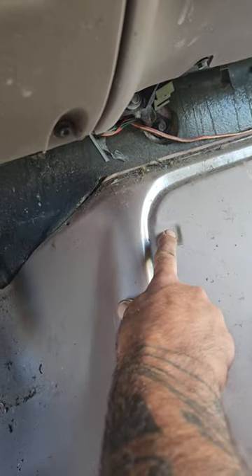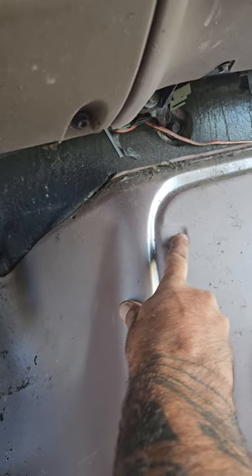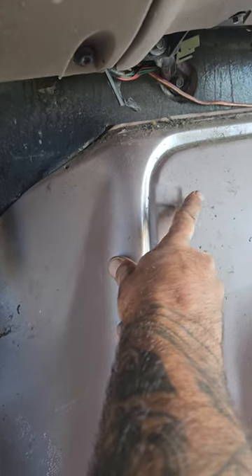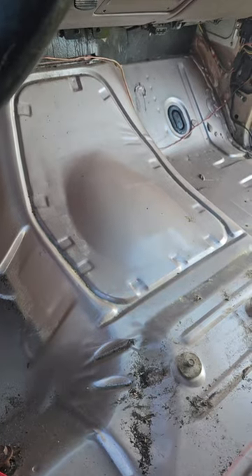This here — you would cut right here and leave this. And right here is already indented. These are where your holes are for your plate. So this is off the parts truck. These holes here line up with these. All you need to do is drill these and put the metal clip nuts in there. The indents and the provisions are already there. I don't say this very often, but nice work, Ford.